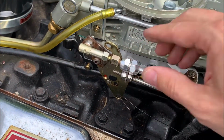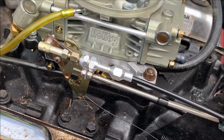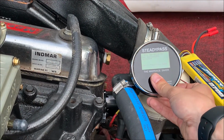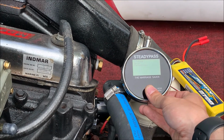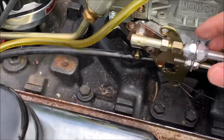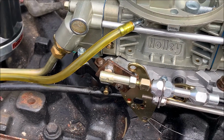This will be worth verifying once after so many hours, just once in a while, that in your default servo position this part is not slacking. Again, device on, you get out of the menu, the values are saved. You do not have to do that every time. You get to your default screen, off or in the GPS mode, doesn't matter. Device will hold its default position. It has to be firm but not over tightened.